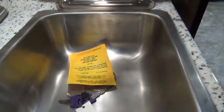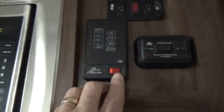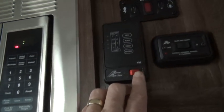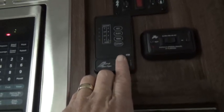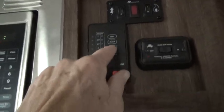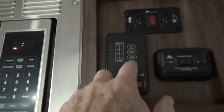Your sink and keys will be in the sink when you get your unit. Up above that is your radio and the slide-out button that brings the slide in or back out. You have your water pump — only turn it on if you do not have city water; if you have city water, do not turn the pump on. This is the demand pump for your fresh water fill. There's a meter here to check your fresh tank, black tank, gray tank, and battery levels.